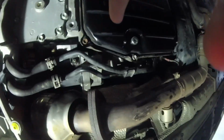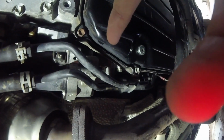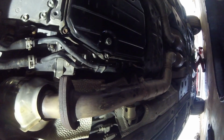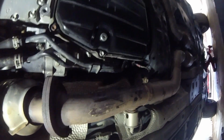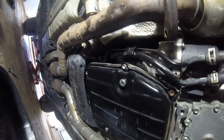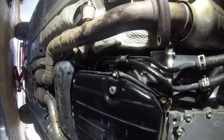So I have to get off these. I think there's 4 bolts that I've seen online for the pump, securing it to the transmission. And people say online to take out the top bolts first, so I'm gonna try to find those. They look like 12mm. I got the top 2 bolts loosened. I had to use a combination of different ratchets and sockets to get the right sizing because they're kind of deep in there past the little hump there.